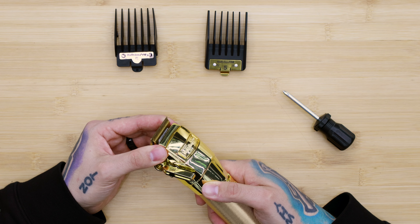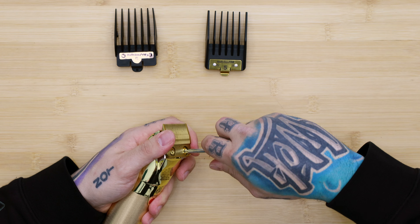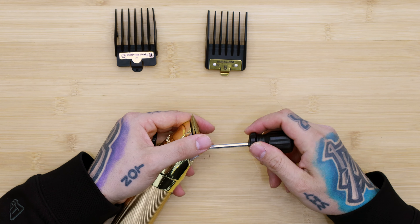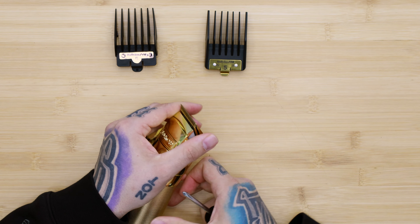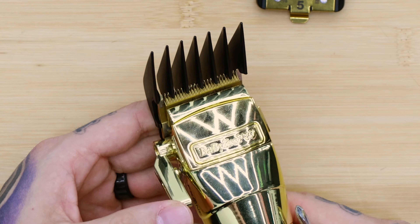So we just want to move them up just slightly — they can still be pretty close. Go ahead and tighten the screws and that will take care of the rattling on the guards. One thing to pay attention to: when you tighten the screw, sometimes it will shift the blade up, so we want to make sure before we tighten the other screw that we shift it back down. Hold it in place as we tighten the screw — I'm looking down the blade right here to make sure it doesn't move. Now you can see they are a little bit further back and we shouldn't have a rattling problem.